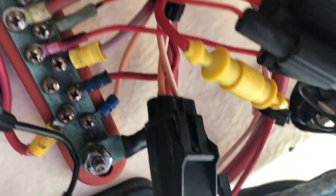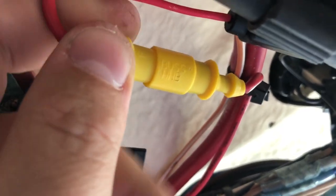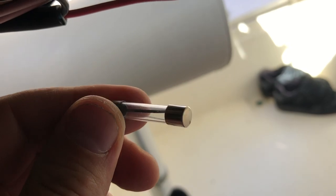One of the things that came up on the survey was that the wiring to the windlass wasn't that good, and the windlass had a glass fuse holder just like this one. I noticed it would work a little bit but not steady — wouldn't work all the time. I took it out and the fuse was completely separated and nothing was connected inside. It wasn't burnt up, it was just old. This glass fuse holder turns out is also the power supply for the trim tabs. This one looks okay and is in one piece, but we're gonna replace it anyway.